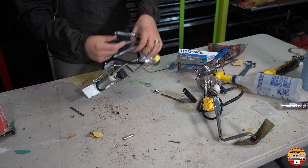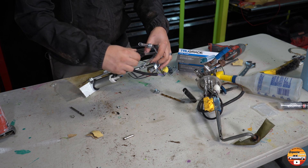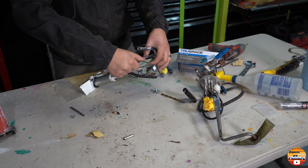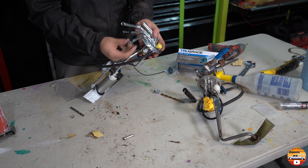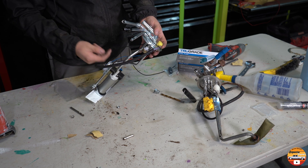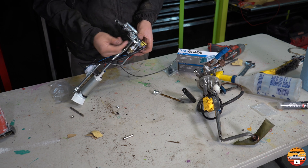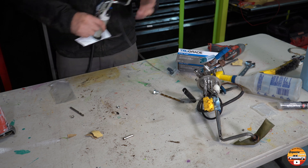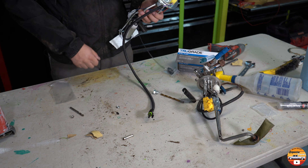Through the magic of television, we got our adapter fitting on there. What that's going to do is allow us to hook our AN line straight up to the sending unit, and we won't have to mess with any clamps or rubber hose in between. I'm going to do this for the 3/8 side as well. This little skinny tube - we could add one there if we wanted to make everything look super nice, but this is just a vent tube. It's just going to get routed up and around to the frame and shouldn't see any actual fuel, just fuel vapor. This one is our return and the 3/8 one is our feed. Once that's all done, we'll get everything back in the truck.